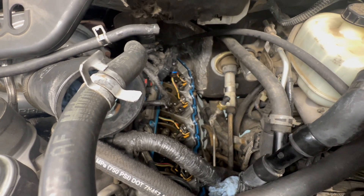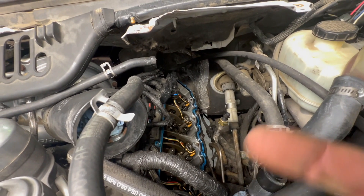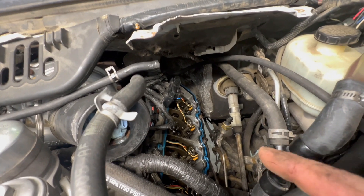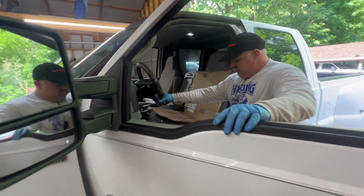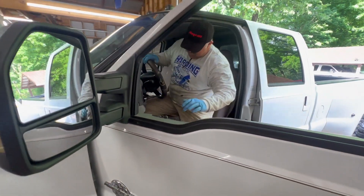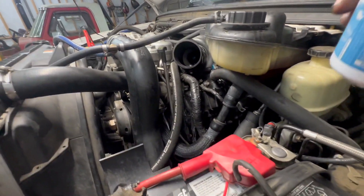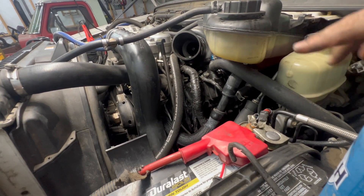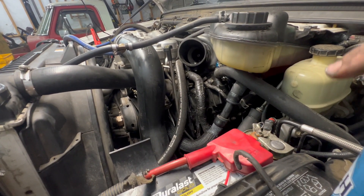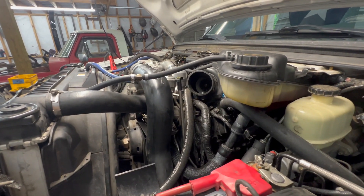It is very important to make sure you blow your injector bolt hole out so there's no oil in it so you get a correct torque. Put it in at 26 foot pounds. We're going to stick our injector plug back up through the head, plug it back in, put our high pressure oil rail on, torque it down, stand pipes, dummy plugs and we'll be back in business. High pressure oil rail torqued at 10 foot pounds, stand pipe dummy plugs at 60 foot pounds, valve cover on, IPR back in, all plugged in. We left the air intake off just until we know we're good to go. We didn't open the fuel system but you're going to have to crank on it a minute because that whole system is full of air.